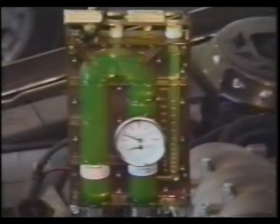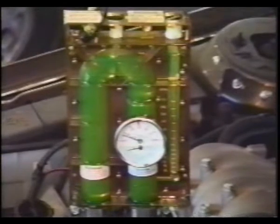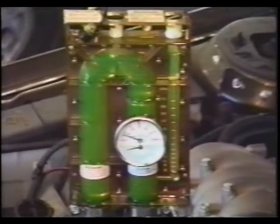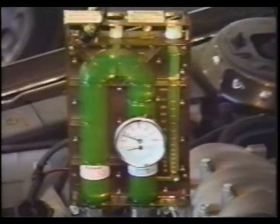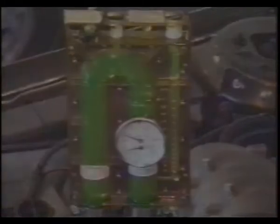Step 6A. Tip the analyzer upside down and strike the side of the flow meter chamber with a screwdriver handle. This will release the ball. Remove disconnect from chamber. Clean thoroughly with the brush. If the ball is lost, it must be ordered from us because of size and weight for exact flow meter readings. Step 6B. Flush engine cooling system and retest.